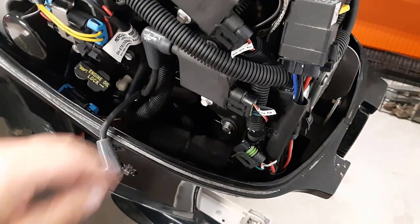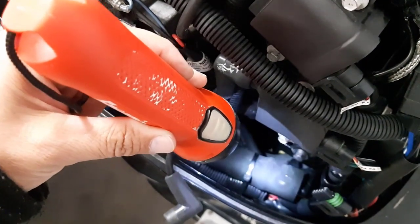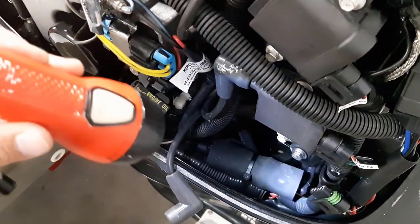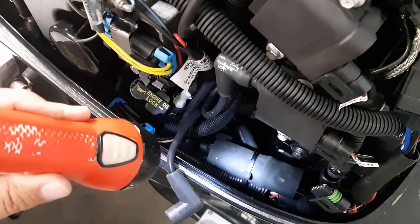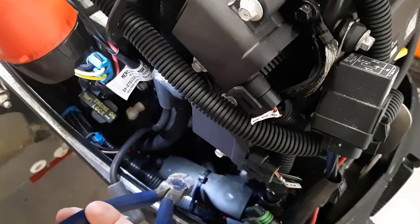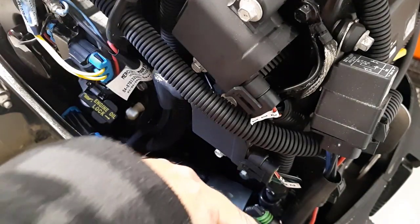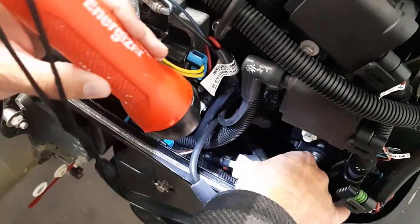There it is — that's the part I had to remove, just some electrical part. Now you can see that right here is your fuel filter, right in there inside that black sleeve with a black plastic tie around it. All you have to do is remove that plastic tie, remove the sleeve, and undo the connections for the fuel filter, put the new filter in — that's it. The hardest part is finding it and getting to it. The plastic tie is just there to strap it to the wiring harness to keep things tidy. I'll cut it off to expose the fuel filter — there, I've slid the sleeve back.